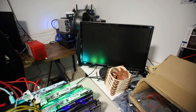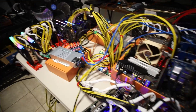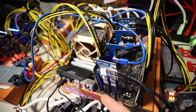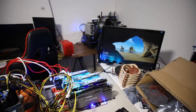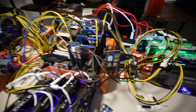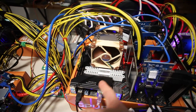Let me shut it down, remove the second bifurcation card, and turn it back on in real time just to verify. We should see the ASRock screen in a second — there we go, 16 GPUs boot just fine on the single bifurcation card, not with the second one. That's really weird — I wonder if there's some PCIe lane detection issue when the other bifurcation card is added, or if I'm capped at 16. I wonder if I could split these bifurcation cards even further, but I don't think so. We verified 16 shows up, but not 17, 20, or 24.